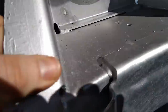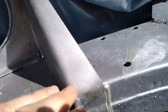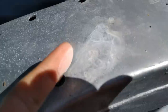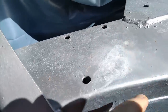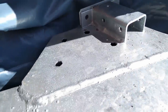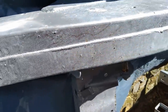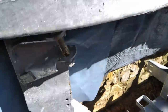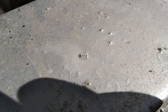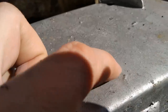The galvanizing face is pretty smooth with a few marks, bubbles, and rough patches. After three years I don't know if there's been some kind of reaction to the galv. In the spring seat there are reactions like this — it's a bit powdery. There might be some water running in and pooling, but as they say, galvanizing is a sacrificial coating, so it will corrode — it just protects the steel. The bottom chassis rails are very clean and nice. On the inside edge there are areas that look like what I'd call eruptions, though I don't know if they looked like that three years ago. It doesn't particularly bother me — it's not crumbling away.